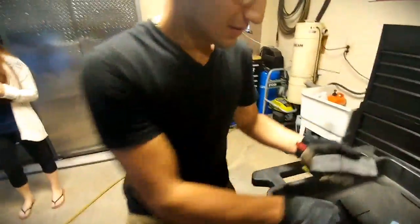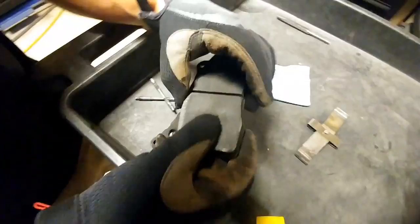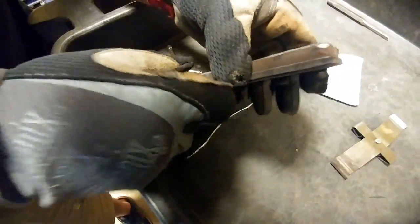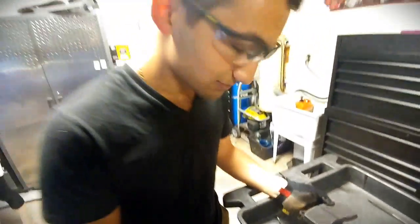So my buddy Milan Mastrossi says that you can make Hawk HP Plus pads stop squeaking. Now here's a little lesson, because it sounded like I needed brakes and everybody would give me those dirty looks. So this is after you take care of them. All you gotta do is sand down the edge on the side of the pad, just so that it's not straight. If it's perpendicular, like a 90-degree angle, you're gonna get noise when you touch the brakes. But when you sand it down and chamfer the edge around the entire thing, you're gonna get no noise, guaranteed. That is Milan Mastrossi.